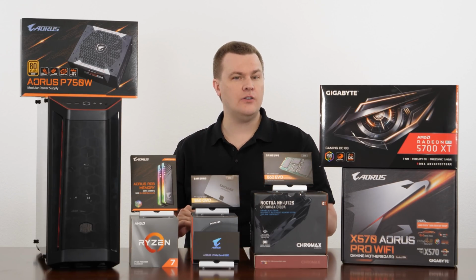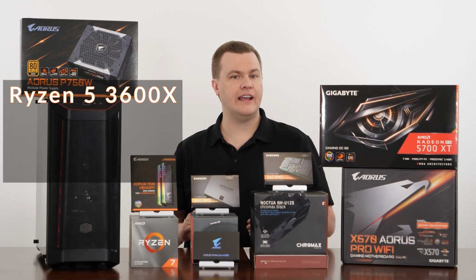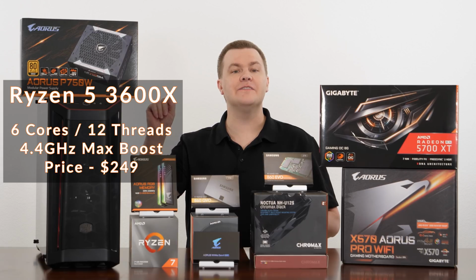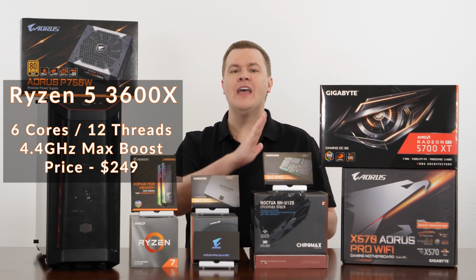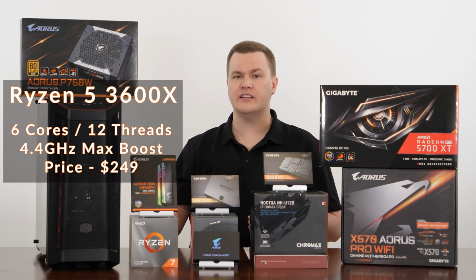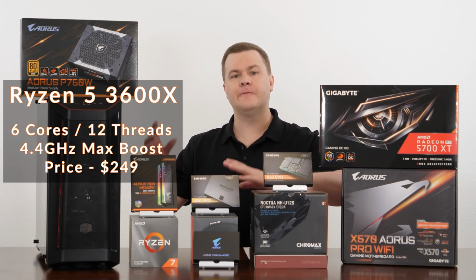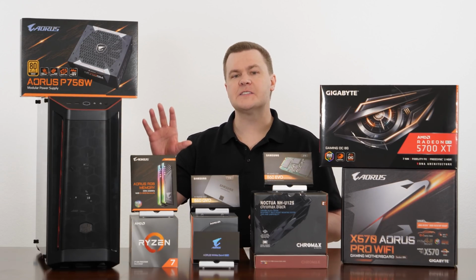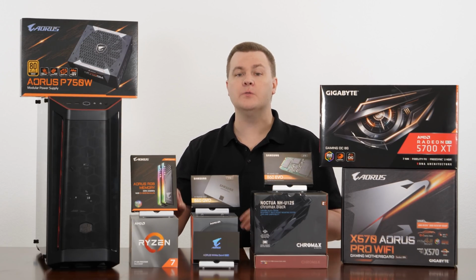You can go down to a Ryzen 5 3600X. I know a lot of people are going to say, but you only need 6 cores to play games. Live streaming PC, I stated that at the beginning. I think you give up a lot to save $100 to go down to a 3600X over a 3800X. And for the rest of the components in this system, it's not worth the savings. Spend a little bit more, get this CPU, it's here for a reason.